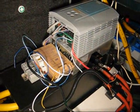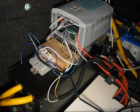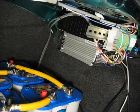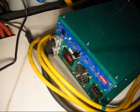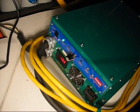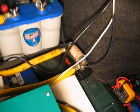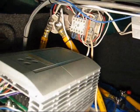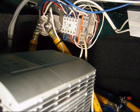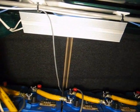So this is what's inside my trunk — that's the inverter that I built, and this is the one that's running sensorless vector. I have my DC-DC converter, which is a 60 amp IOTA unit, and this is my charger. As you can see I'm pulling almost 20 amps at 240 volts. I have a 300 amp fuse which proudly has never blown, and then there's my pre-charge contactor, my main contactor, and my pre-charge resistor.